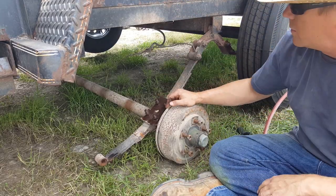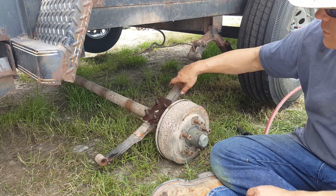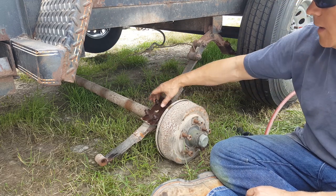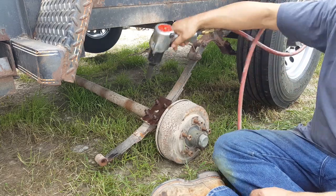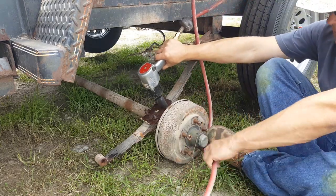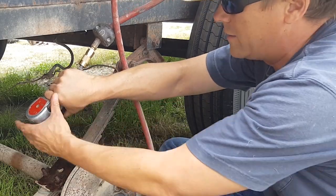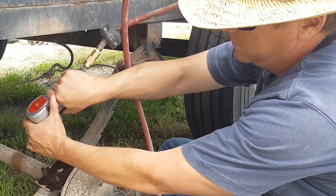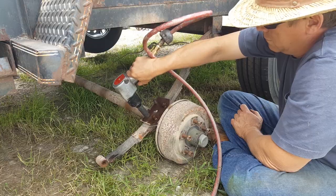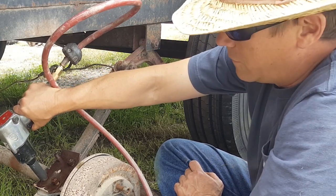The second axle is actually going a lot faster than the first. I figured out that if you loosen up one of the bolts holding on the leaf spring, you can drop the axle down and then actually get an impact wrench under here instead of having to do it all by hand with a hand wrench, so this is a lot faster. Any time you do something more than once, the second time is always faster. Hopefully people learn from doing stuff and just don't do the same thing over and over again.